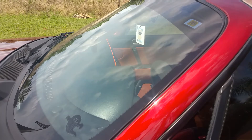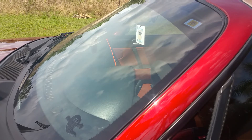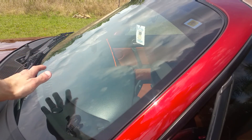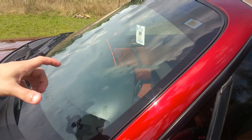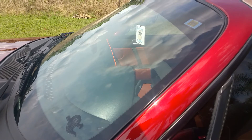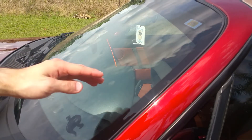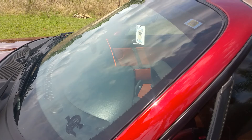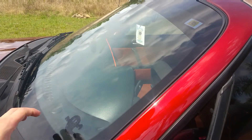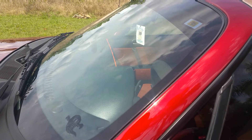That's pretty much it, and as you can see it didn't take me long at all. That is the cheapest, easiest way to clean your windows and make them crystal clear. Like I said you could theoretically put paste wax on here using foam pads and just rub it in, but the issue is it's going to leave an even thicker layer unless you really work it in carefully. I don't recommend it because when your windshield wipers go across the window you'll see those streaks, it wears out really quick, ends up on your wiper, and you'll have uneven water repellency. So just put it on the side windows, rear windows, and the interior.